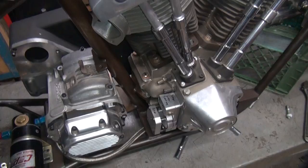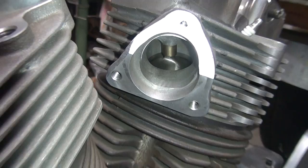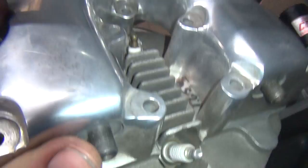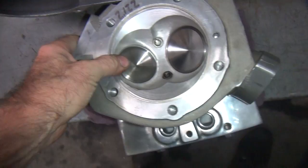One thing about modern times — you've got more options for doing stuff. So this here is the head. These are your exhaust ports here. They actually use shovelhead intake valves in here — these are 1.950 valves used for the exhaust. There's your piston. I put one of these rags down here so I don't scrape up this motor too much. There's your combustion chamber.